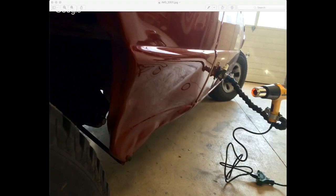Porta Power was definitely, I forgot that part of the whole process. After we did that homemade brace, we did end up using a little bit of a Porta Power from the backside. Patrick actually brought that up. I said that when I sent him the picture, that's what I originally used as part of a Porta Power. Porta Power with a baseball glove. Wow. So you use an old baseball glove on the end of a Porta Power and it gives you that padding and it'll move a lot of metal. Well, you're in that baseball town, Baltimore. So that's it. Stadium's right there.